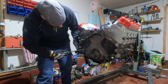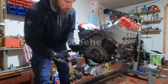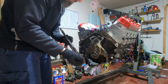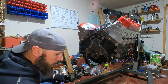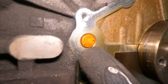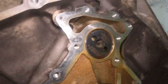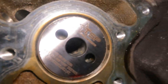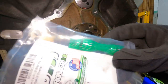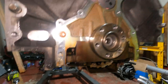I got something a little more aggressive here. There we go — a couple of love taps and we are almost out. We got this guy out. Also part of the objective of getting in here — right there, that's our little oil diverter, AKA the barbell. We wanted to get to that too. So we're going to get that out and clean up back here a little bit. Texas Speed cam. We've got the new barbell right here — this one's aluminum, that one's plastic trash. Change it while we're in there.